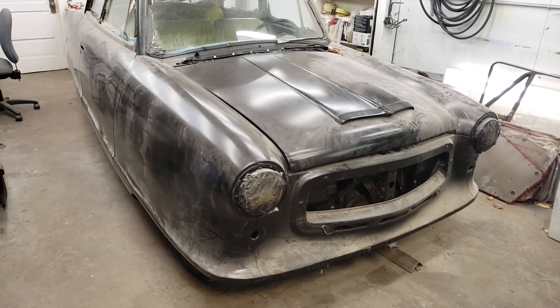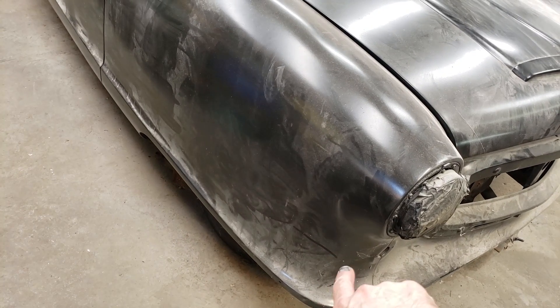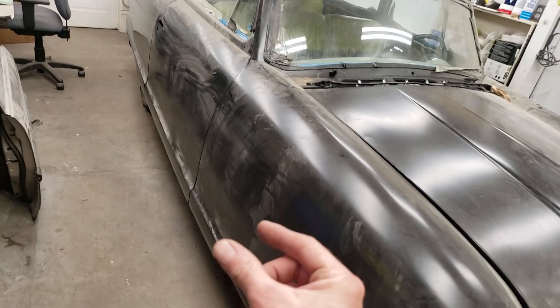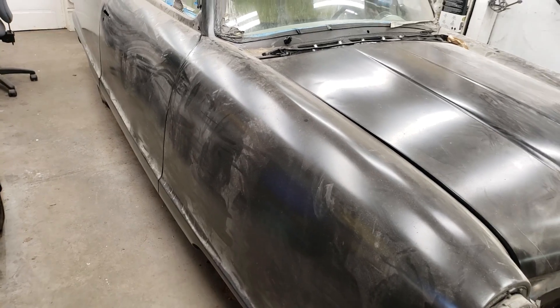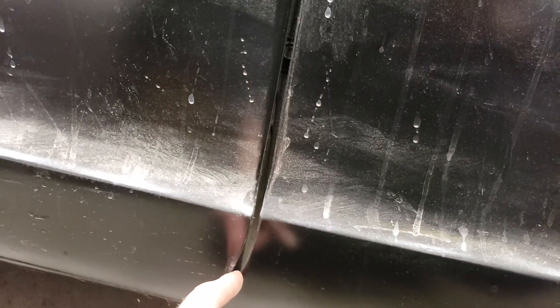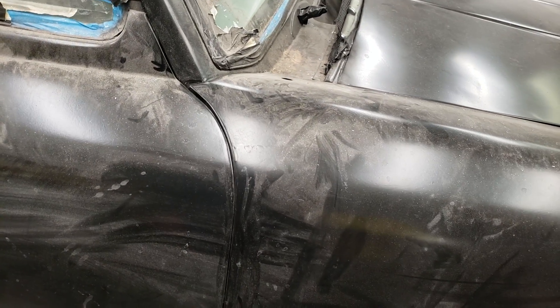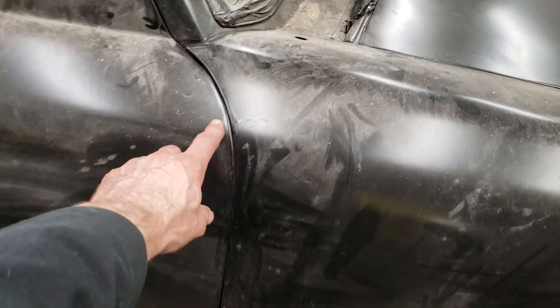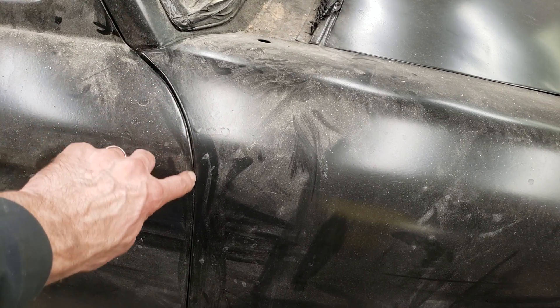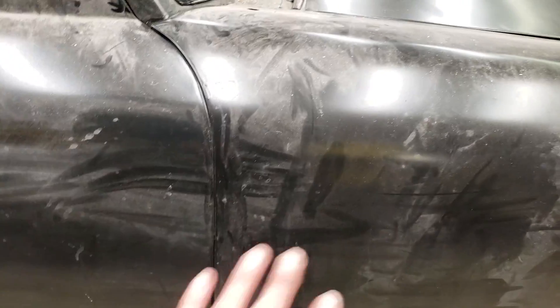I was driving it every day — it's been about five years now. This side was pretty well creased, basically from the front where the bumper would be all the way back there was a gash about that deep, so I pounded it all out, filled it, and fixed it. Where I'm stuck is right here at this door gap — it's a normal half-inch, three-eighths of an inch, and as we go up it gets tighter and tighter to the point where it almost touches, then widens up again. The unibody has never been compromised.